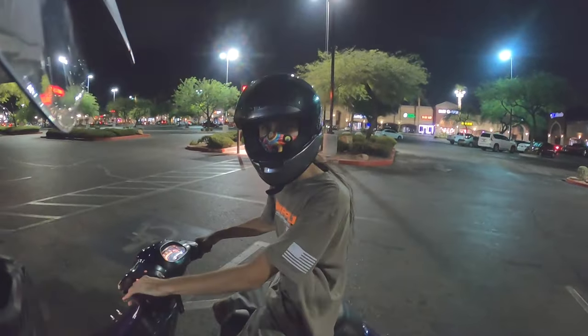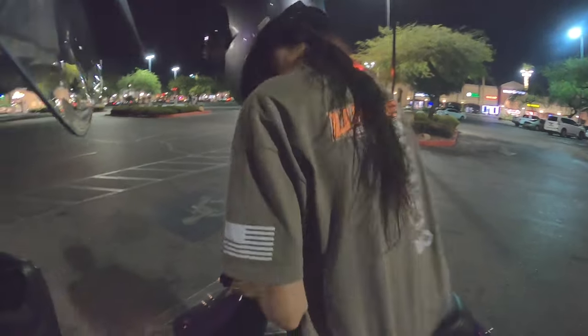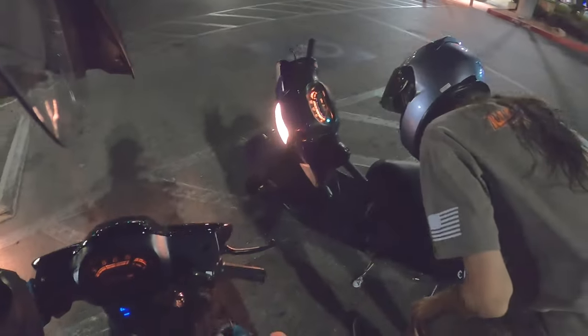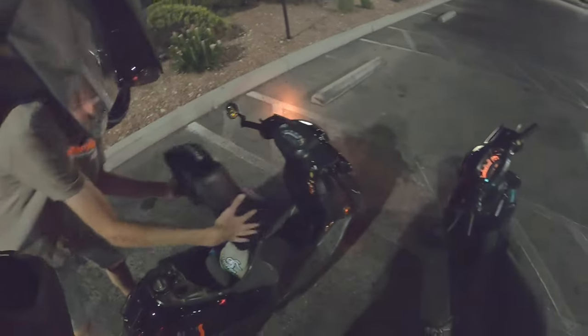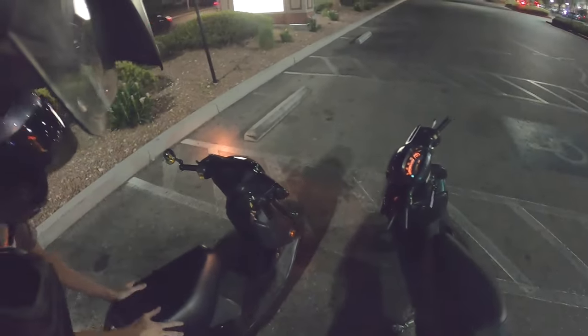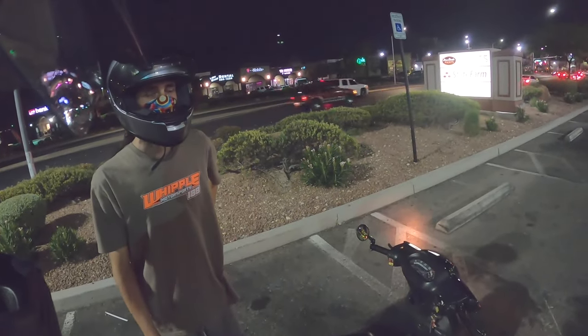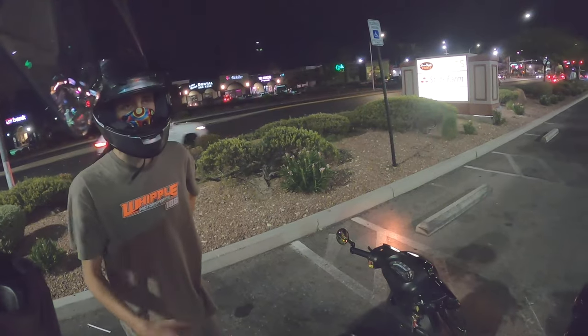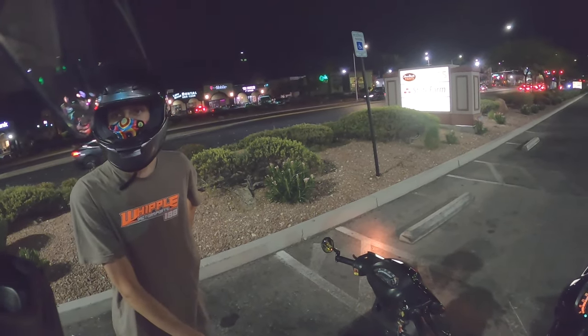When I was holding it, it kept pulling through, but let me do some changes on the carb. Is it worth more fuel? I think so, but you would know more than me. Go re-jet. Yeah, more fuel, you think? Yeah. What size jet's in that? 132, and not like smaller jets though. 132 and 50, or no, I have a 39 size in there.